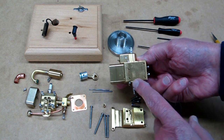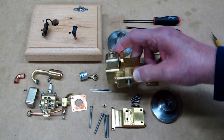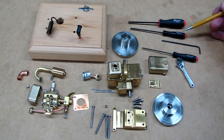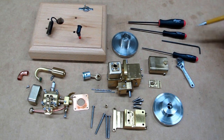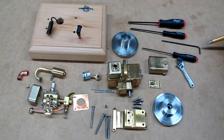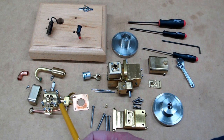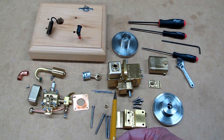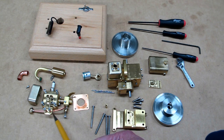I was kind of surprised that this was not open on the bottom. This is your head gasket — it's a piece of copper, it's very soft, so you want to be very careful with that. You need a 1.5mm, a 2mm, and a 2.5mm allen wrench. The ball end is handy, but you need a regular end for tightening things like the head bolts. These are your two push rods that just push in here and come up and work these two valves.